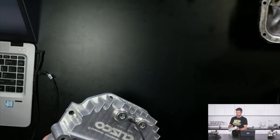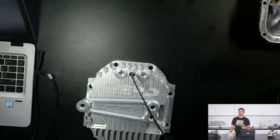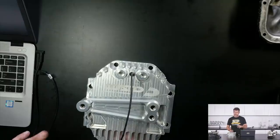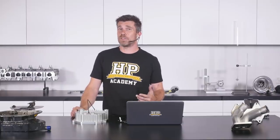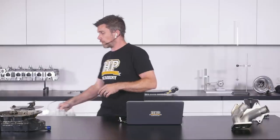The part that people missed is that one of the reasons we're actually fitting this cover is not so much for the additional capacity or the fins to help cool it — what we're doing is using the two fittings on it to adapt up to an external oil cooler. We're going to be actually adding an external diff oil cooler. We've also added a temperature sensor so we're going to be able to monitor our diff temperature and see exactly what's happening. While the diff cover on its own may not be a silver bullet for fixing overheating problems, by the time we've got an external pump and cooler fitted, we're pretty confident that's going to be more than up to the task — and for our use we're going to be using this for endurance racing, so it's pretty important that it's reliable.